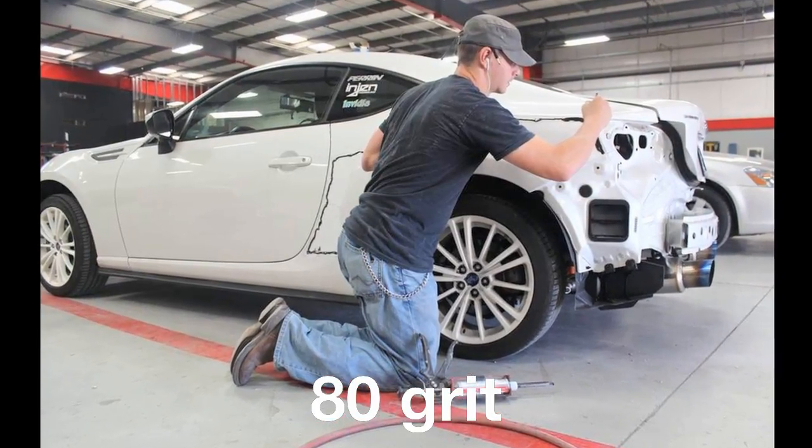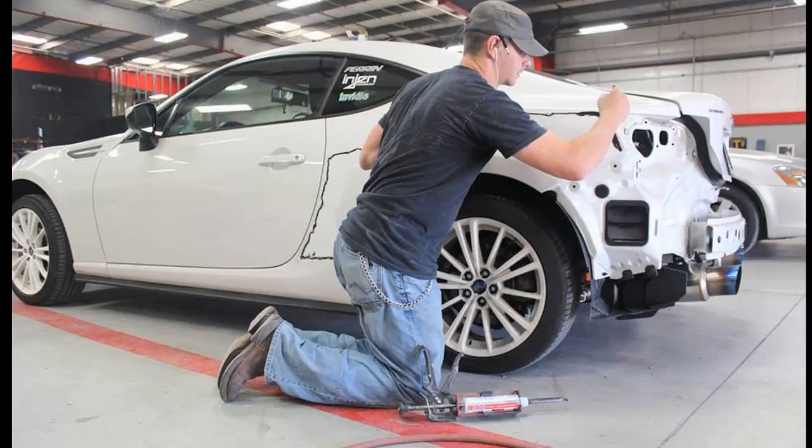Gluing the kit to the car. Everything is prep work when you're doing bodywork. So you have to sand off the clear coat, give it some more bite so the glue can actually stick to it. The glue to use will be in the description. Pretty much everything will be in the description.